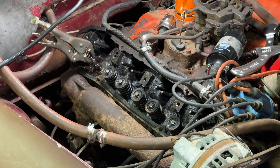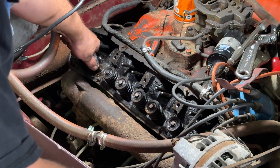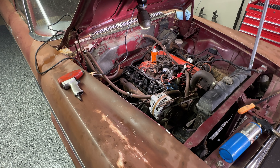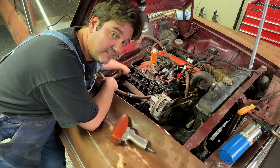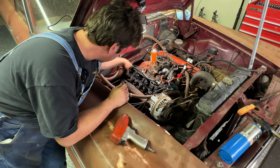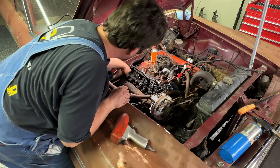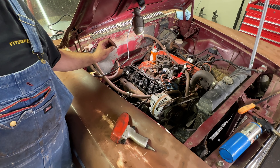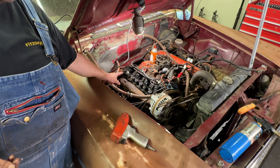How am I going to clean that up? Let me get some emery cloth. After all that, we finally got the valve unstuck. I don't know what this thing is — I want to say it might be some kind of tap holder that you can put on a three-eighths drive — but it came in instrumental for holding the valve, getting it to twist, and working it back and forth. I'm sure I'll keep putting more oil in there because there's rust coming up. If I can charge that cylinder with air, I can put the umbrella seal, the spring and retainer, and the keepers back in. Then that valve should be freed up.